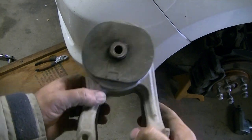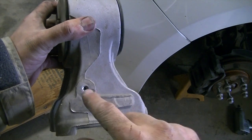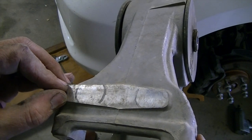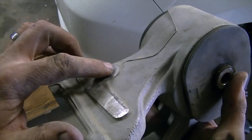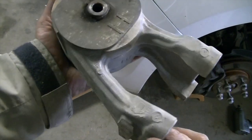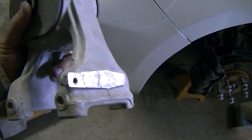Looking at the removed rear mount, it doesn't look like it's in terrible shape. We'll do a quick comparison with the new one. Just so you're aware: there are two holes on the side that hold accessories — possibly a power steering line. It's easy to forget orientation. This side faces toward the front of the vehicle. The mount looks symmetrical at first glance but it's not — there's a slight cant, one end lower than the other. High end goes forward, low end goes backward.